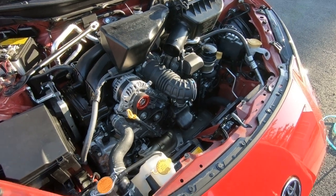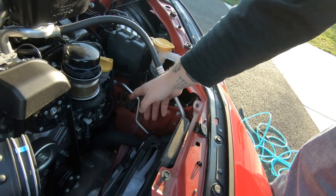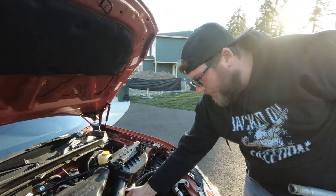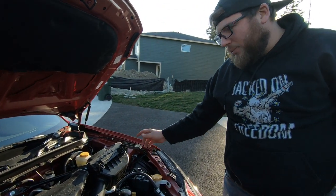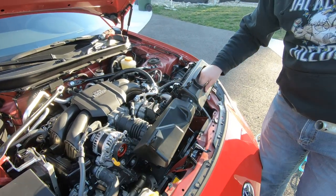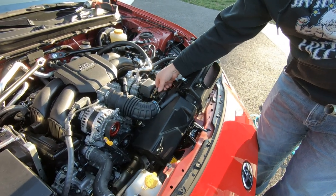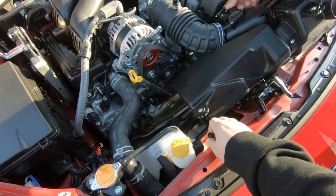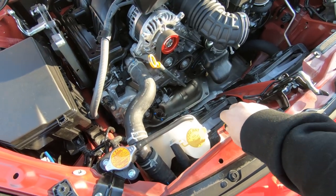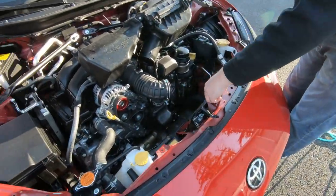To take the air box off, you're gonna have one, two, and three 10 millimeters — bust them off. I disconnected it even though I didn't have to, to be safe. The air box is super easy to pull, and then to put it back on it'll just rotate it down, get it inside the little coupler, tighten it, make sure the connector is hooked up, and it'll be straight easy from there. Thank you Joe for pulling that out — you are the world's best recorder, biggest help ever.